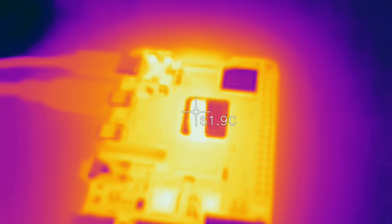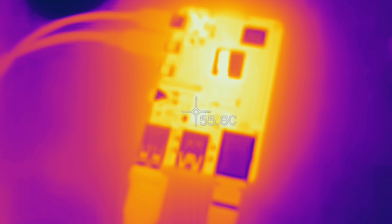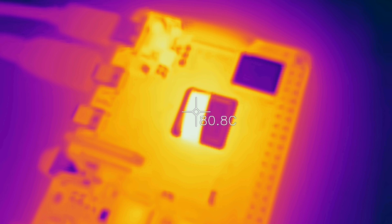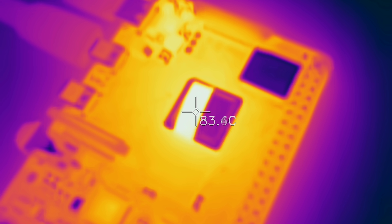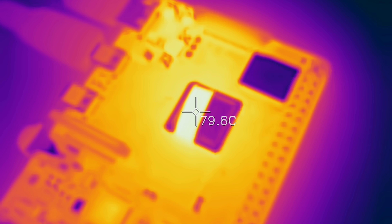As expected, the Raspberry Pi 4 does run a good bit hotter — 62 degrees on the CPU when idle, the hottest of the bunch. When printing, it bumps up to 65 degrees, which is not a lot. That low temperature increase tells us it's not spending much of its resources supplying G-code to the printer. When running a stress test on all four cores, it does heat up to 83 degrees Celsius and it does throttle — but that is a synthetic load. I've not seen throttling in real use with Octoprint; it always runs at full clock speed there.